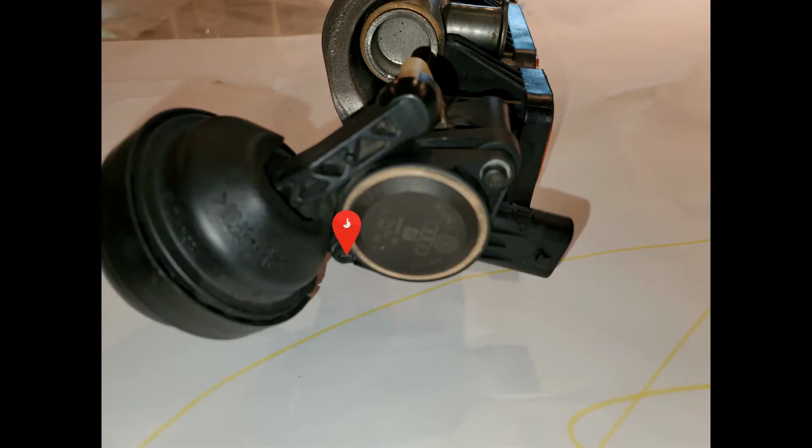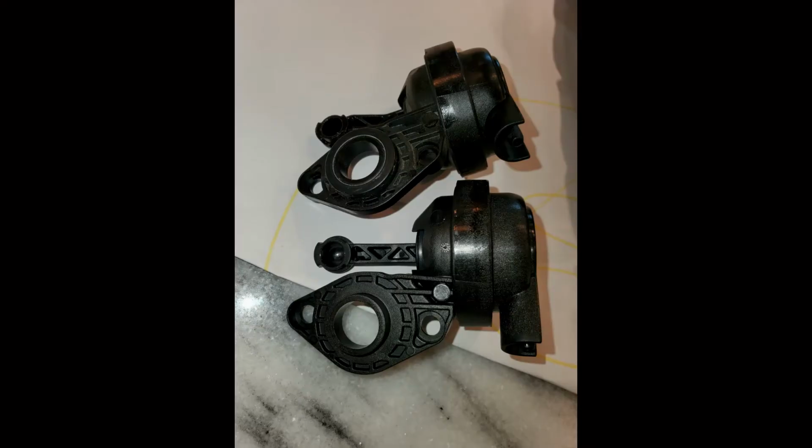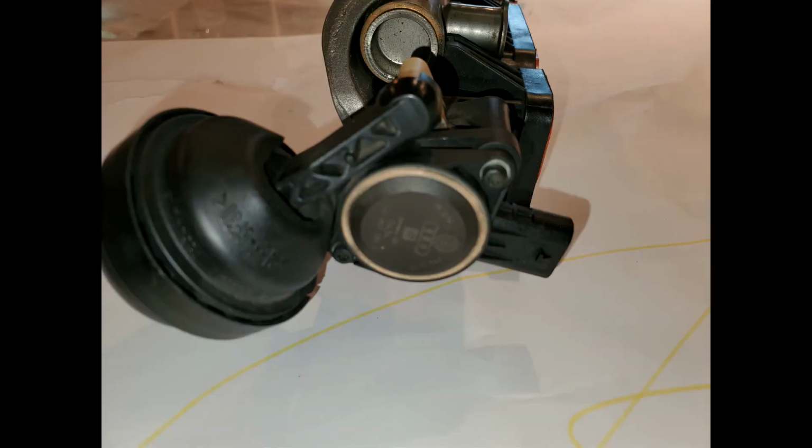Alright, so to fix this, the first thing you have to do is remove the two screws from the position sensor. And then from there, you have to disengage the ball socket, and that will remove it. I do apologize that I don't have much of any of this captured on video, but I assure you it's pretty simple. Also, to remove the supercharger on 3.0T cars, FCP Euro has plenty of videos on how to do that for different reasons, and I could even include one in the description if necessary.